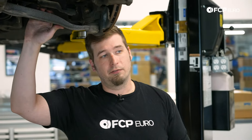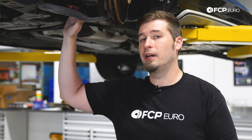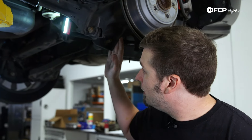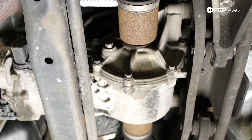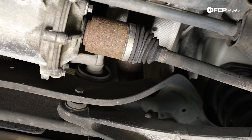That's pretty much all there is to know about the front suspension on the P3 chassis. If you're used to working on Volvos, you'll find this is easier to work on than a P2 because you need less special tools, especially with the ball joint. Now we're in the back section. As you can see, there is space back here for a differential and axles. If you have all-wheel drive, basically the only difference you're going to notice is a differential, a Haldex unit, and some axles coming out here.